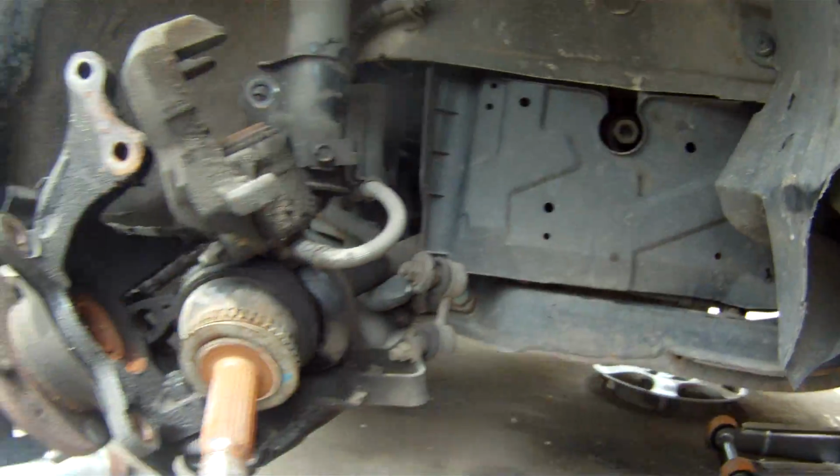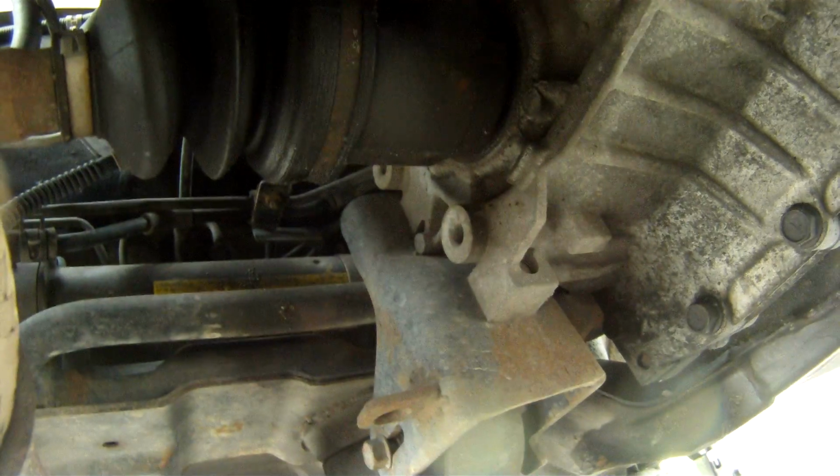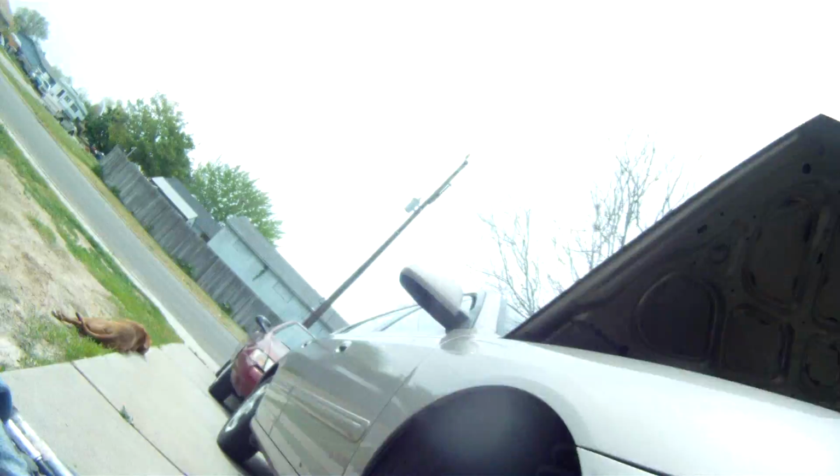The next step would be to get under here and look in here. Now, unless you see a carrier bearing or some type of bracket that bolts this all together, all you should ever really have to do is get in back here with the pry bar. Of course, you probably want to have something ready to grab your fluid that falls.